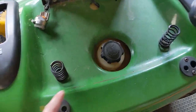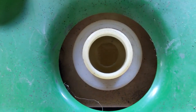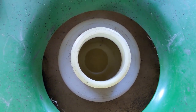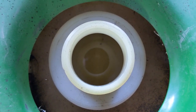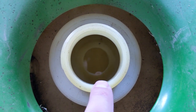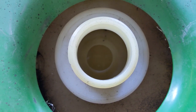One of the things I always like to look at is my customer's fuel. Removing the cap and looking into the fuel tank, I can see a little bit of debris. However, the one thing that sticks out more than anything else is the smell emanating from this fuel tank. You guys don't have smell-o-vision, but this stuff smells like watered-down fuel, almost like rubbing alcohol. It doesn't smell like fuel at all.